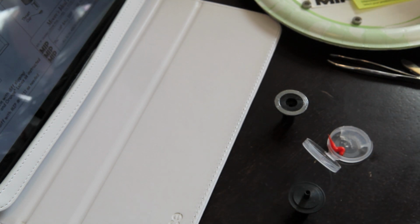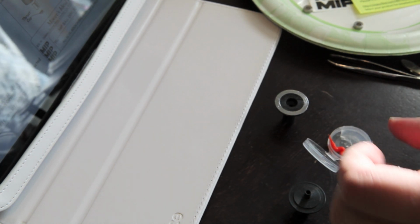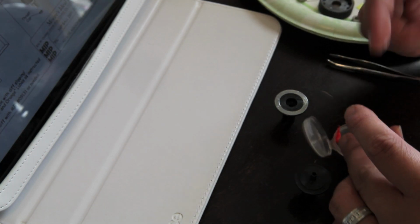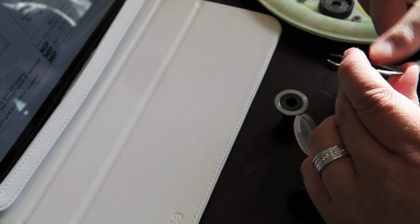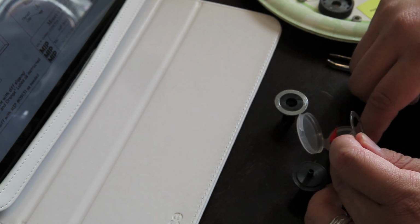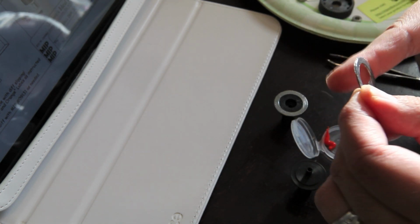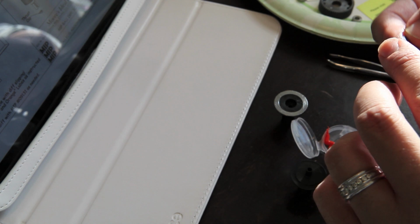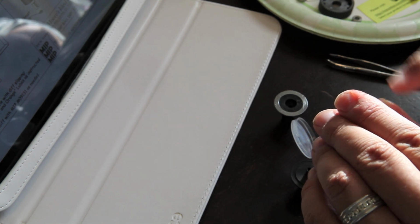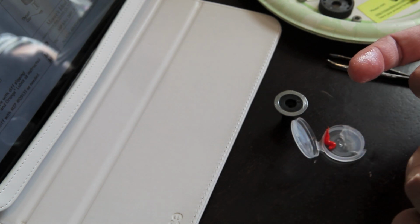Also, some people actually use sandpaper, so you could sand the rings before you apply the grease. Sanding is done for a couple of reasons, because if you don't sand, the rings might be too noisy. It might generate extra noise from the differential gearbox, or transmission gearbox. So you probably want to sand it first too. But in this case, I'm not going to show you the sanding step, and just show you mainly the assembly portions of this ball differential gear.